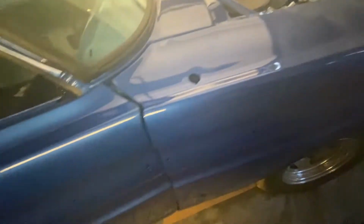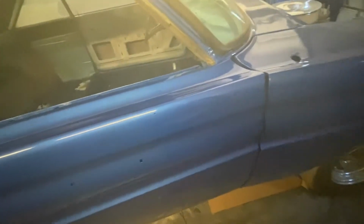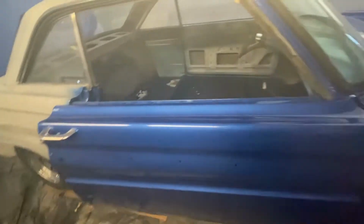But you know, that's the cool part about it. Even though I got these spots done, it is base coat, clear coat, so I can go ahead and put all the stainless down the side and the anodized aluminums and door handles. I can just tape all this stuff off and fix the little areas I need to fix, wet sand the whole thing, fix the areas I need to fix, shoot some blue, and re-clear it all.